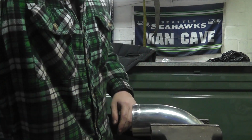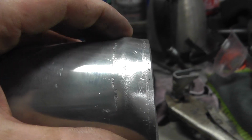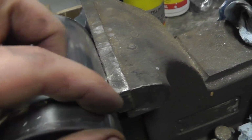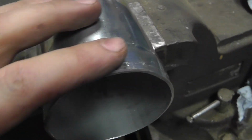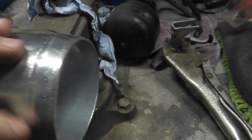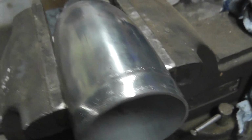It's not perfect, but it gives you a pretty nice little bead that you can see would definitely help to keep the pipe on. In fact, I might set the grips a bit tighter and give that a bit more of a bead, because I want it to be nice and secure. But you can see how it works. It's pretty good. I mean, without buying an expensive bead rolling machine, it does a pretty good job. So let's carry on doing this.